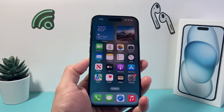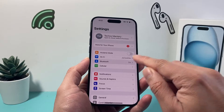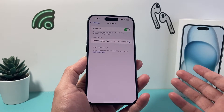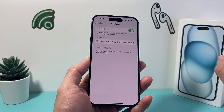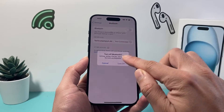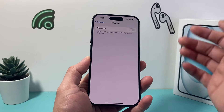After you have done that, the next thing to do is go into your settings on your iPhone and check the Bluetooth device. You want to check if it's connected to another Bluetooth device — maybe your AirPods, car, or another speaker. What will happen is the audio will get routed there, so you won't hear anyone. I recommend turning off Bluetooth and see if you can hear them on the call now with your regular earpiece.